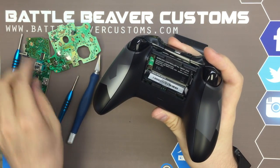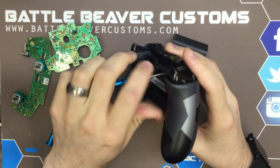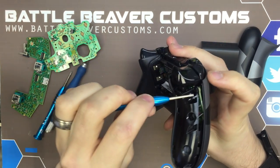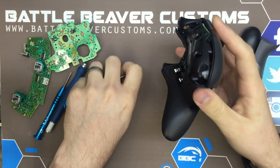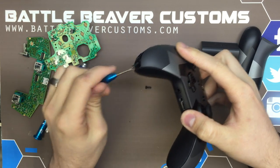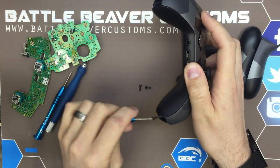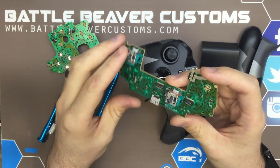There's a new warranty sticker from Microsoft that looks a little different — it's missing a barcode or something. Not that we're too concerned about warranties at this point. We'll pop the side caps off. Everything so far seems to be about the same fit as far as plastics. And I'm skipping over the big thing here at the bottom — the 3.5 millimeter headphone jack. That's the big improvement. They had used adapters to switch from 3.5 to 2.5 and everything in between, and they had a lot of issues with that proprietary connector — it'll actually shear completely off the board.